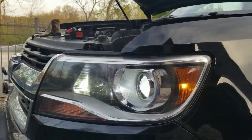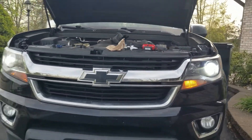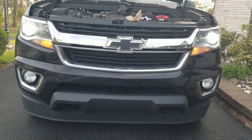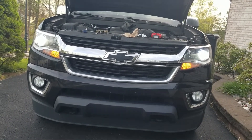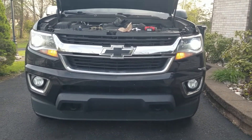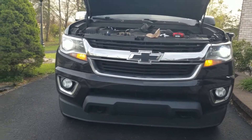The front side marker light still has the original bulbs. For the driving lights to work you need the engine running and the emergency brake off. The headlights, driving lights, and side markers are all now replaced with LED. The high beams aren't done yet — I'm not replacing them until they burn out.